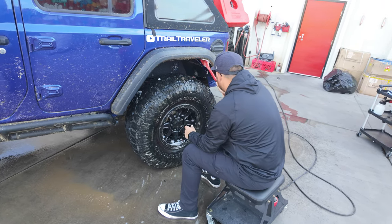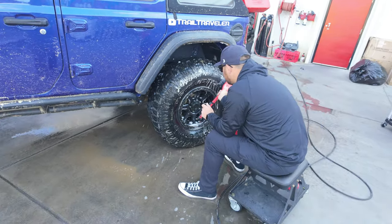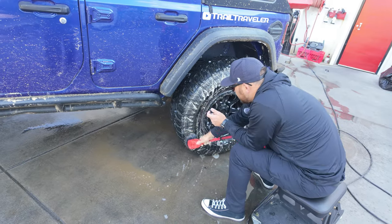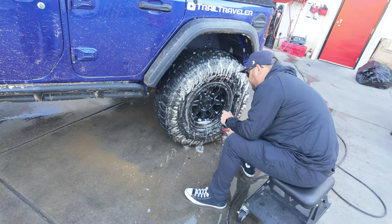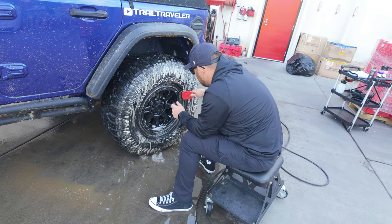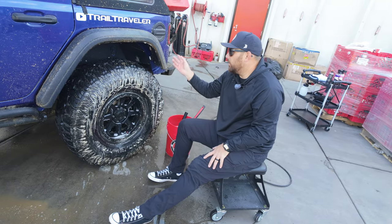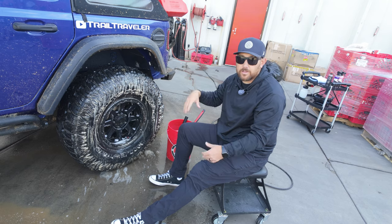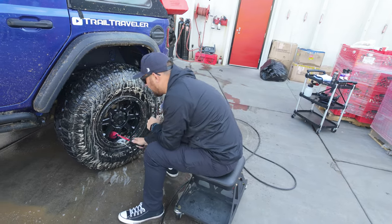It was just amazing how well that dirt just dropped right off of those fender liners. And I'll say this too, wheel cleaner is probably one of the harshest products you could use on a car, on your wheels, just because the cleaning power needs to be so much. There isn't a chemistry that we sell, that any of us have access to in public, that will deteriorate a ceramic coating. The way to make the ceramic coating start going away is to abrade it off, like polishing with the machine. So I'm fine with spraying that wheel and tire cleaner into the fender like that.